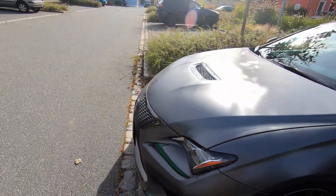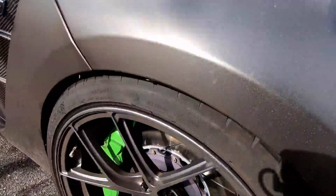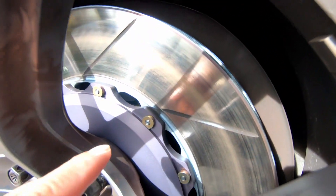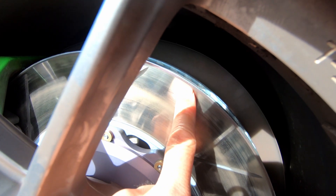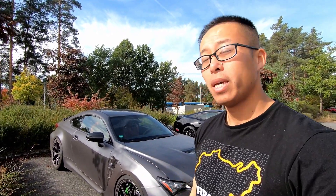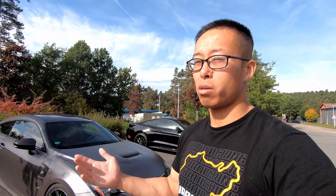Let me show you the other side. Here, you can definitely see the bluish tint right there. You can also see the same thing right in the middle — it's a lot of friction, and it's really soft here, and friction there. I'm going to show you the process of how to bed in the brakes, because bedding in brakes will help the brake rotor last longer and it'll help the brake pad last longer, too.